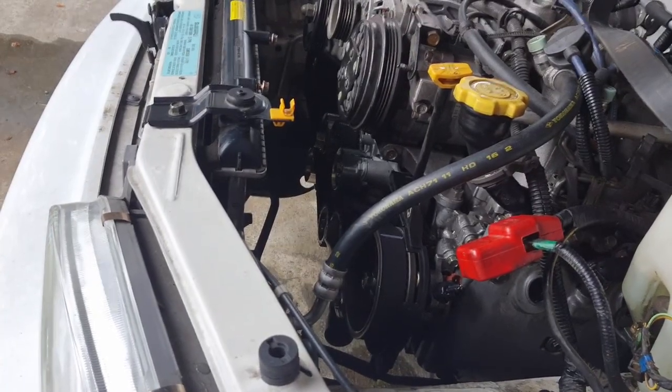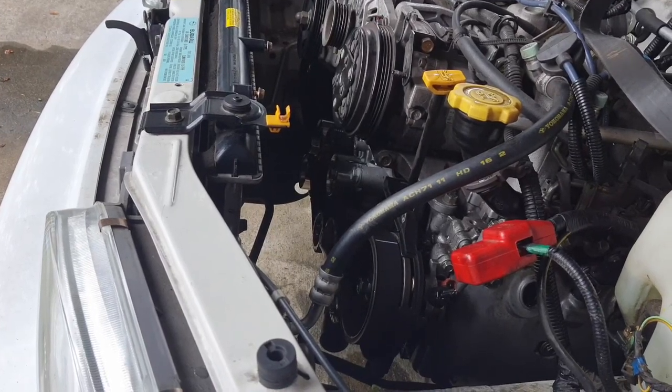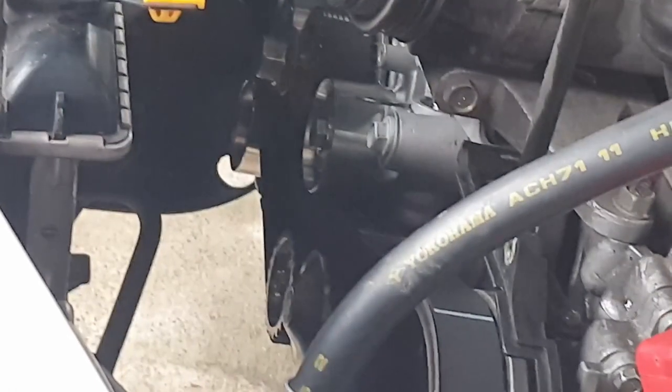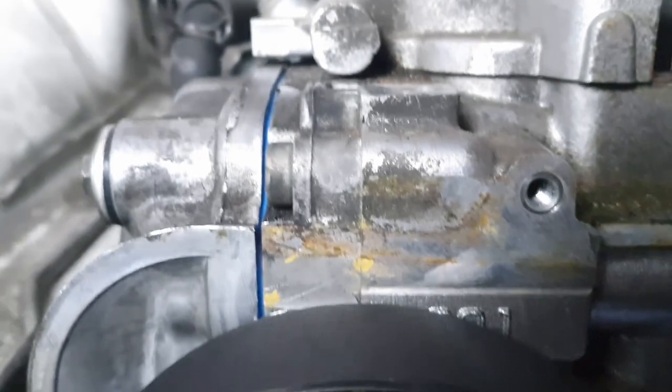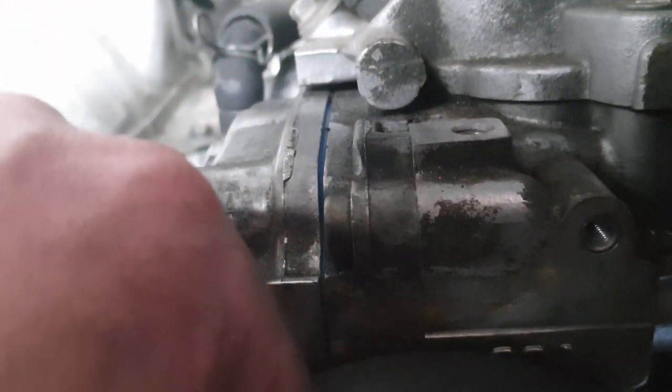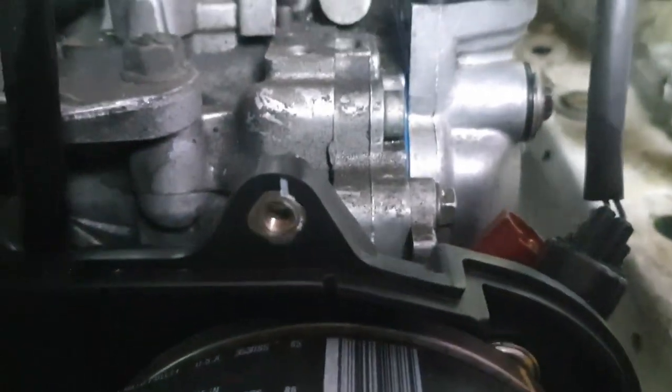Anyway, now I just have to get the tension on the bottom. I rolled the engine over once. The belt timing marks no longer line up, but I know that they were at the right positions when I started. So all that's left to do is pull the pin and then tension this thing up. So the pin is pulled, and I've basically checked that all the timing marks that were on the gears are accurate. You can see that pen mark that somebody did, and that timing mark at the very top. And then on the right hand side, again, that's basically where it is. The line is painted a little bit weirdly, and the dot isn't perfect, but it's within a margin of error for these single overhead cam non-interference engines. And same with that. So yeah, we're good.